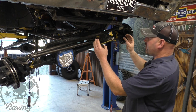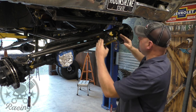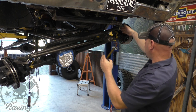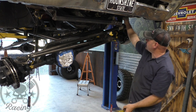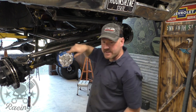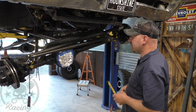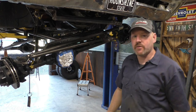When we put our towers in up there, we want to make them so they're going in towards the engine — but not so far that we can't get the engine out. We want to go in towards the engine to keep them at that angle so that in the compressed state it's not hitting on the outside, and in the extended state they're not hitting on the inside. It looks really good, but we're going to have to be very mindful of that.